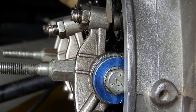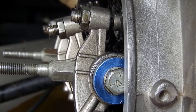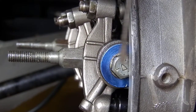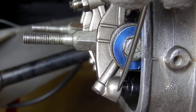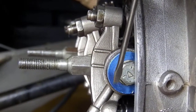I'm at about 89 degrees but it's pretty close to 90. From this edge to this edge, we want to see that sitting as parallel as possible. That reduces the amount of tension — you can really see the socket down here that it sits into — and it reduces the angle and the amount of tension that is actually put on the rocker arm.